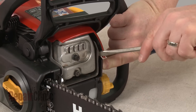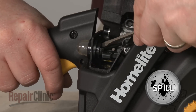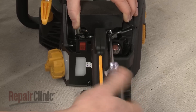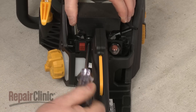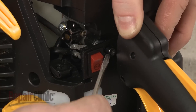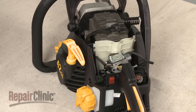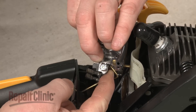To access and uninstall the carburetor, first remove the top cover. Detach the carburetor fuel line from the primer bulb — be prepared for some fuel to spill. Next, unhook the choke lever. Use the T20 Torx bit screwdriver to remove the carburetor mounting bolts. Lift out the air filter housing and separation plate. Detach the fuel tank return line from the carburetor. Note the location of the throttle linkage and detach the carburetor.